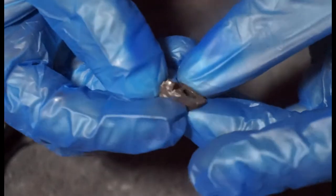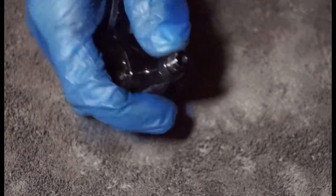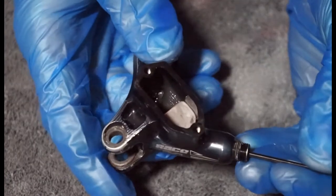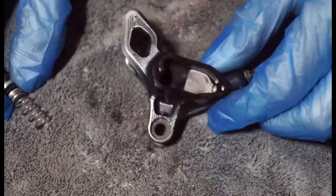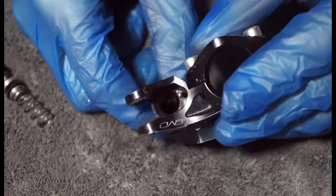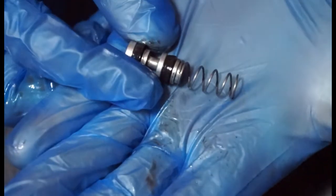A little bit manky on the back. And then what we have is a dirty piston. We're going to need something very small — I'm going to put it in that hole there. I really should get something made of plastic so I don't scratch the bore. We just slot that in and you'll feel it butt up to the piston. Just slowly push it, try and keep it nice and centralised. And that essentially is your master cylinder stripped apart. I'll give that a little clean up, spray it with alcohol spray and a cotton bud. Here is your piston system, which is a little bit dirty as well. And the spring comes off, and you're just left with the piston and the seals.